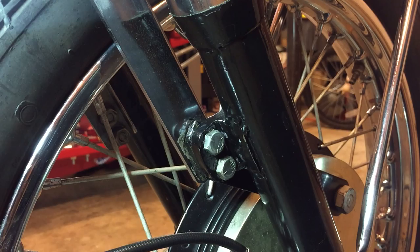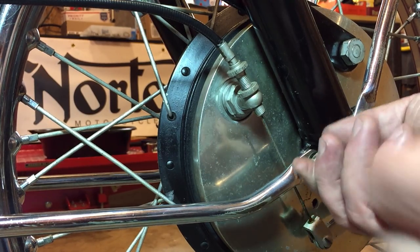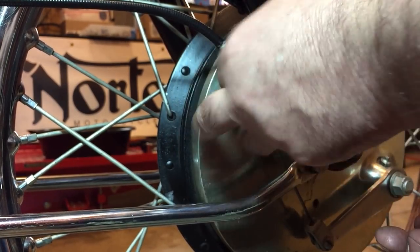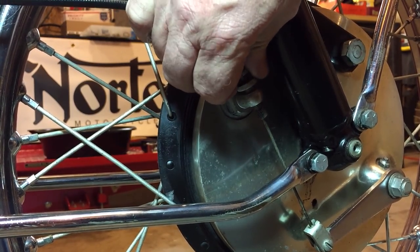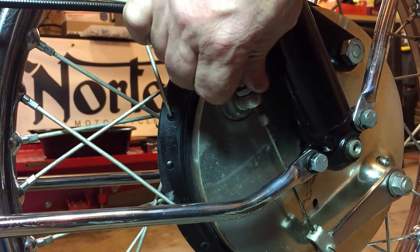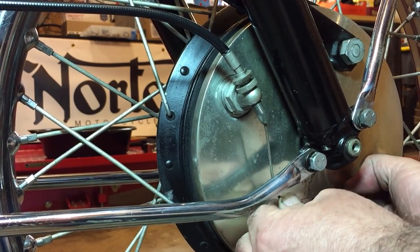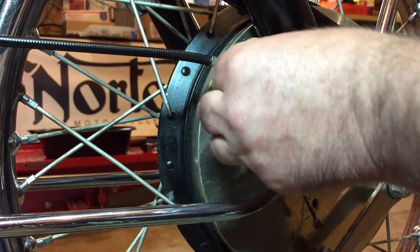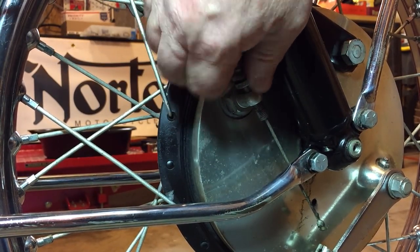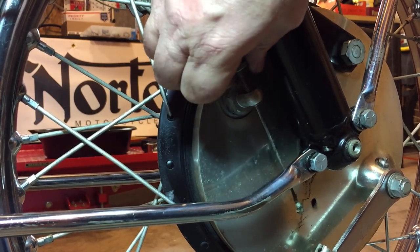Just to loosen things off for when the wheel comes off, next I'll work on the brake — loosening off the brake cable to remove it down below. All I'm going to do is slacken that off, which will loosen the cable. You'll see the brake lever at the bottom is slackening off, and then hopefully there'll be enough give in the cable at the bottom that I can just pull it out. We'll have to readjust the cable of course when this all goes back on.